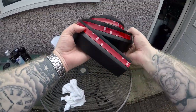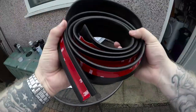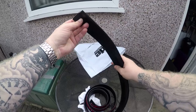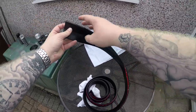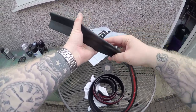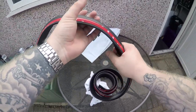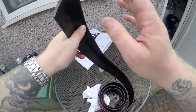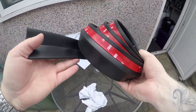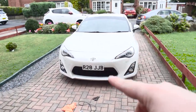This is the rubber splitter — as you can see it's got some 3M tape on the back. It's actually quite a lot heavier than the ones I've had before. What you're supposed to do is lay it along the bottom of the bumper underneath with this bit being the contact patch, and then follow it all the way around. If there's a corner or a curve then you're supposed to make a split so it bends around it. Rigidity is not particularly a bad thing — the only difficulty is lining it up, making the cuts straight and clean, and making sure you get the middle right.